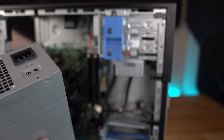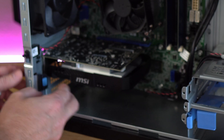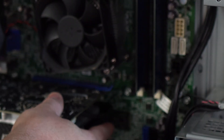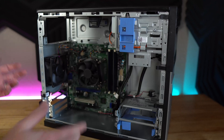With only two connections coming off that stock PSU, it's not going to do well powering a higher-power GPU. So we're going to get the old GPU out of here as well. You just push in on the Optiplex locking tab — the OEM retention feature — and pull up on the PCIe tab slot, and out it comes. The little baby GPU is out.